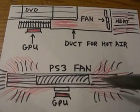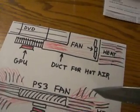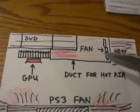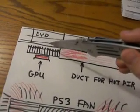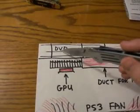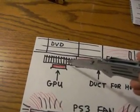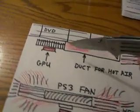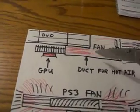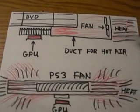Therefore the PS3 is a good design, Xbox 360 is a rush design from what I can see, not very well thought out. I also think the DVD drive placement is causing disc read errors too, because this DVD drive gets so hot that it actually causes the disc to warp while playing a game, which throws everything off. That's just stupid design, Microsoft. I hope you do better and learn from your mistakes on the next system.